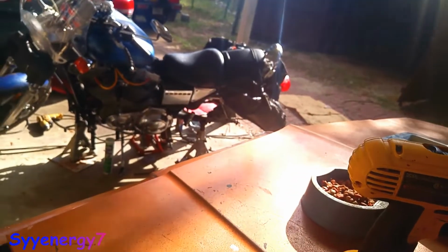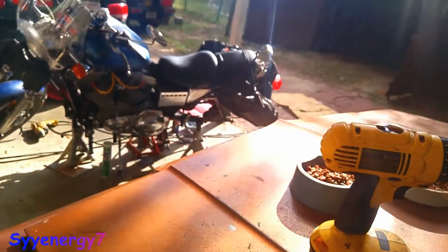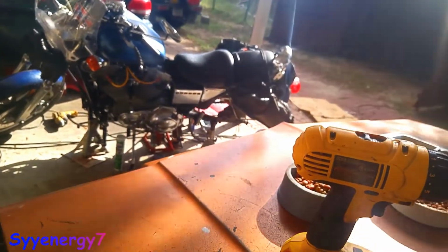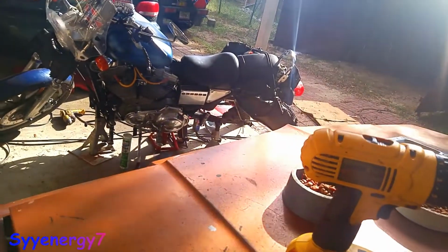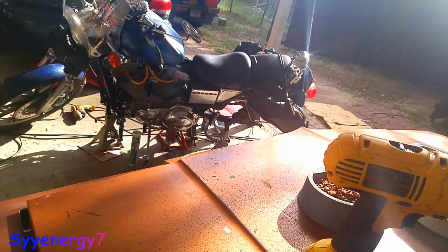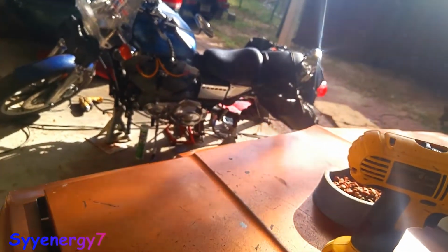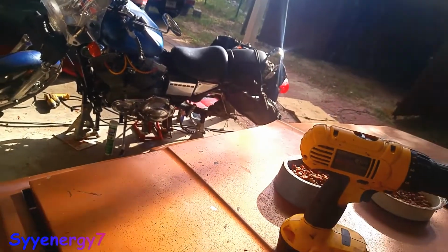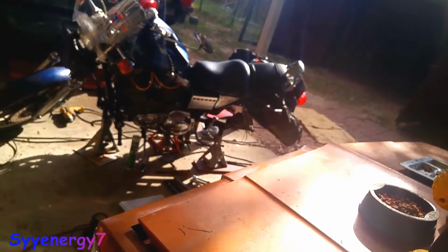These guys at Harley, man, they could have put a couple of grease fittings on that thing, but what they're doing is, it's called job security for the dealership. That's what it's called. But like I said, the reason these bearings, the wheel bearings, like actually any of the bearings, really, it's contaminants that kill them. If you had perfect lubrication all the time, I don't think you'd ever change these bearings. They'd probably last 50 or 100 years, for crying out loud, with using a bike every year, a bunch of miles.